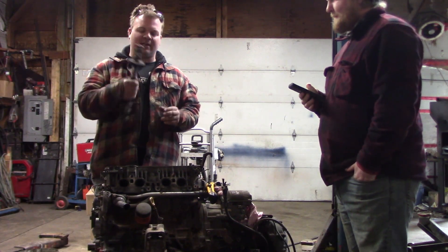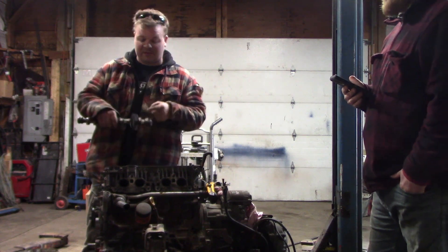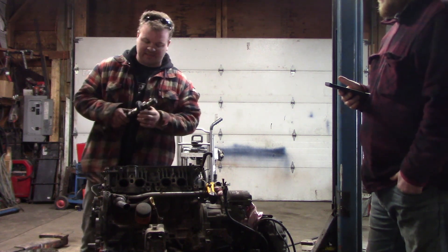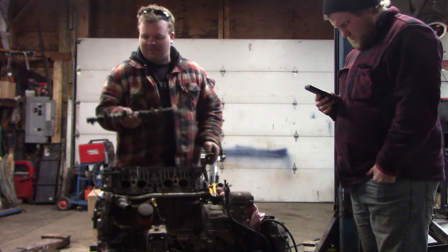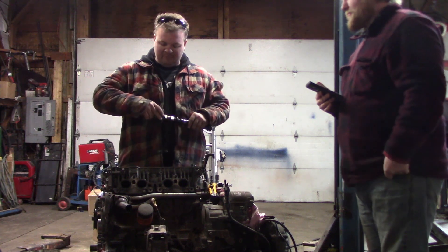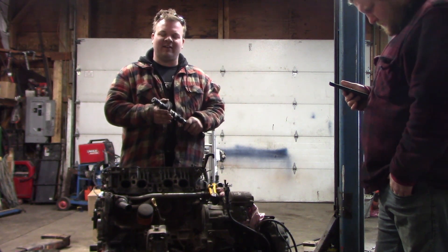Here is an old beat-up cam I was going to turn into a trophy and give away, but this is the perfect thing to show you the problem I noticed. When I took this apart I put paint marker everywhere. I actually marked both sides of the gear — I thought it was redundant, but I'm happy I did. You see this gear? See that break in it? It's got a spring in it. I sat there for 30 minutes thinking there's no way the lines don't match up. We're going to put this back together with the spring preloaded, making sure the paint marks line up.